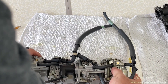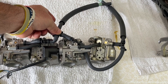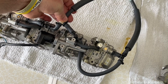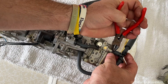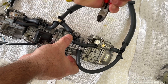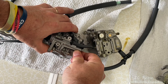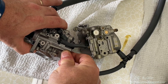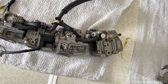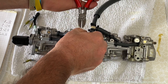This plate also held the accelerator pump and impinges this cable, so I remove the cable now to release the plate. Now we're just dealing with the carbs. We'll bring it forward to remove the fuel hoses — we can see the top line was taped and went to a white connector, and the other hose goes to a black T-connector. The black one terminates at carb four and then comes up to carb three. I'm going to cut the cable tie at carb four, and then cut the cable tie going to carb three off the T-fitting.